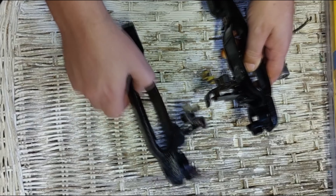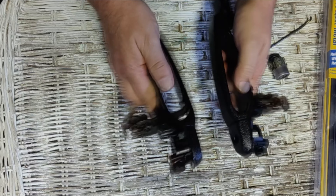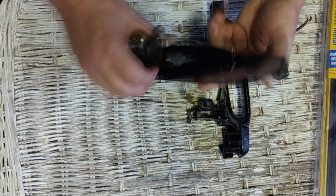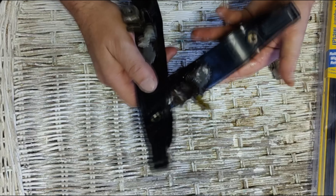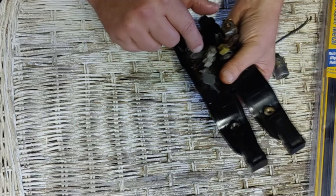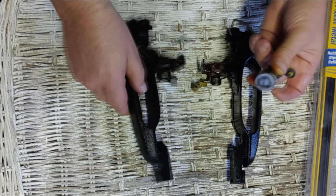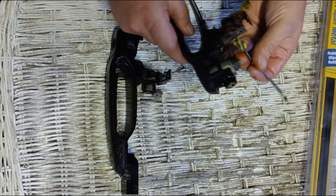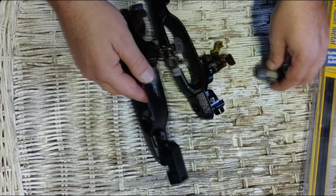Before I go putting these handles back in the van, I just wanted to show you the major difference between them, because you can see they're basically the same handle. By changing the inner part - I can't now because I've metal welded it in, there are two clips and both of mine are broken so I've metal welded that into place on both. But they're basically the same handle - you've just got to swap over the piece. So if you've got a broken left handle and you can only get your hands on the right handle, swap the insert over and you've got a left handle. Same with the door lock - it's interchangeable as well, it can go on either side.